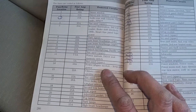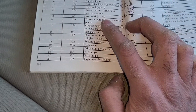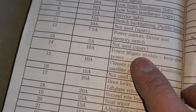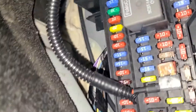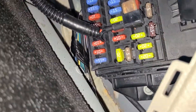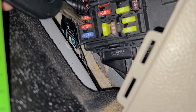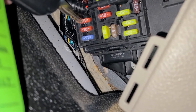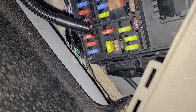If you own a Ford Expedition with a power liftgate, you want to check two more fuses. The first one is fuse number 14 — it's a 10 amp fuse, the power liftgate module fuse. That one is the third from the bottom, this red 10 amp fuse. The second fuse you want to check is under the front hood.